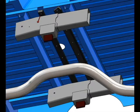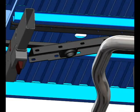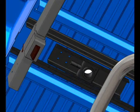Refer to instructions when making sure the crossbars are turned to the correct direction for install. The crossbars are now in place and ready to install the center section of the hitch. Each truck is a little different, but you should slide the center section over the exhaust and fit it into position between the crossbars.